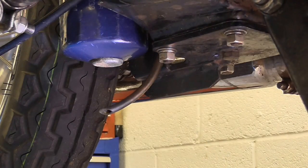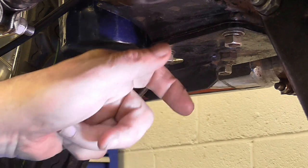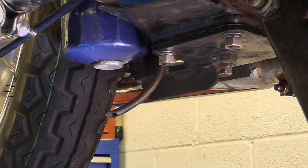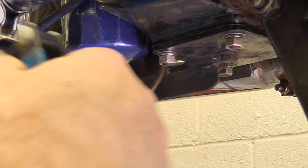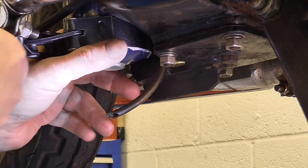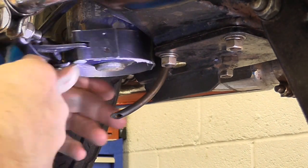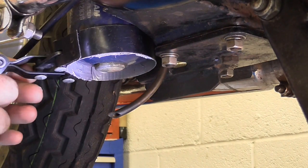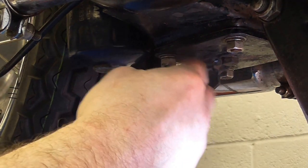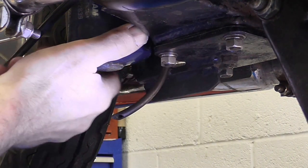What I'm going to do now — because of how I've got my oil filter mounted, right underneath on a bracket here — it makes it impossible, it's right against the back here, and I cannot get my hand round it to physically undo it. So what I have to do is use this cast-off snap-on old strap wrench and just crack it off first. It's not that it's tight — I physically just cannot get my hand round it to undo it. So I crack that off first, because being as it's mounted to the plate, if I take the plate off it means I struggle to get the oil filter off. So I take that off and take the oil filter off first.